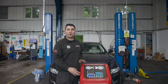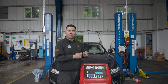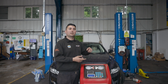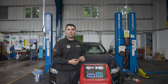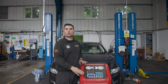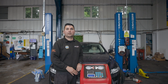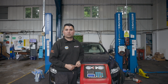This should massively improve workshop efficiency because it allows us to break into the automatic transmission fluid system and replace it without having to take sumps off or drop sump pans. Get the car up, connect it to the system, and in about 15-20 minutes we know that 100% of the old fluid is out and replaced with 100% new — which isn't something you can normally achieve by just draining and refilling an automatic gearbox.